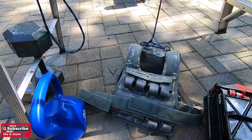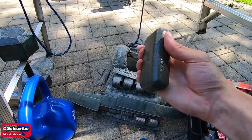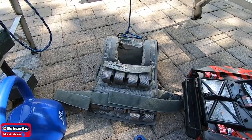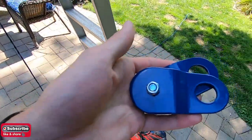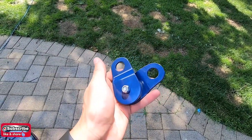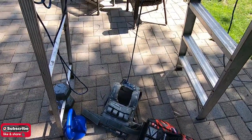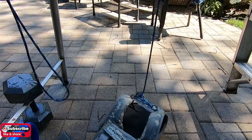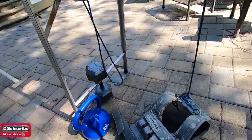We're going to be picking up this weighted vest and I'm going to be adding 2.5-pound iron weights to the vest every time the car successfully makes a run. Once we find the limit, we're going to add another pulley — another snatch block. For those that don't know what a snatch block is, it's basically a pulley that breaks apart so you can put it on the line much easier without threading it through. The more parts of line you have — however many pulleys you have added — the more weight you're going to be able to pull.